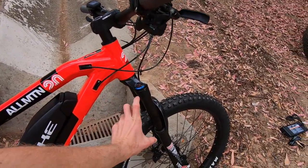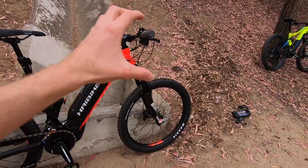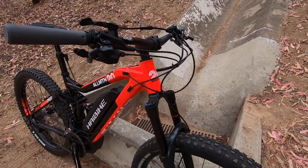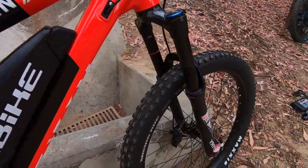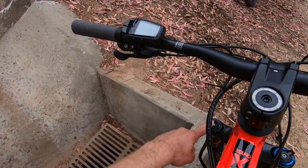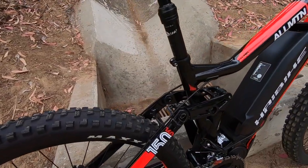About 100 millimeters of travel on the dropper, 160mm up front and 150mm in the rear for the actual suspension — a little more up front to absorb bigger hits. It has a tapered steer tube and being an air fork, it's a bit lighter weight. We've got compression adjust here, rebound and rapid recovery down there, and you can adjust the sag and air pressure. Same thing goes for the rear — compression and rebound adjust.